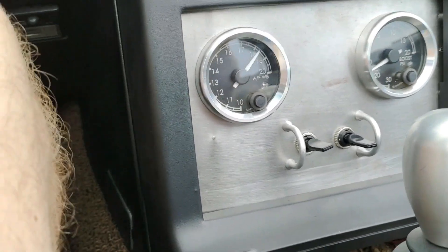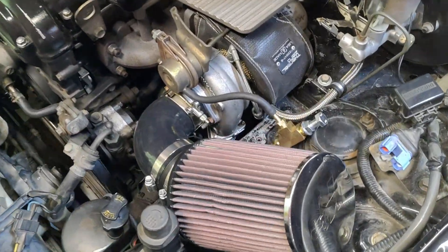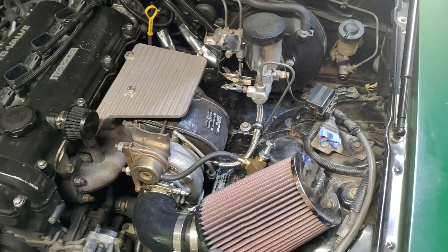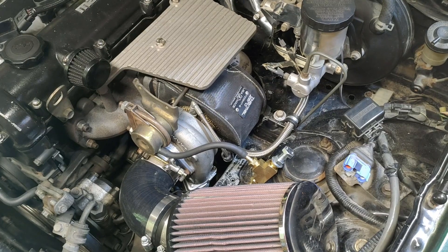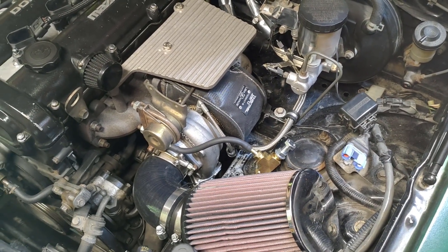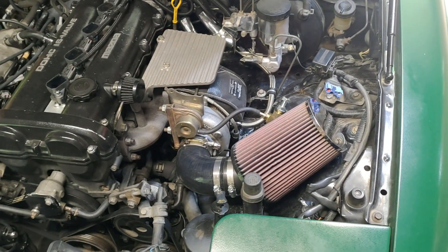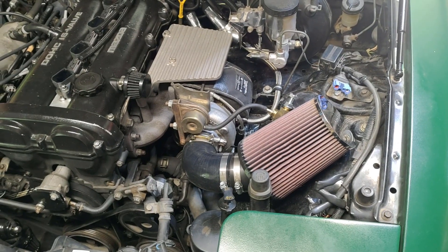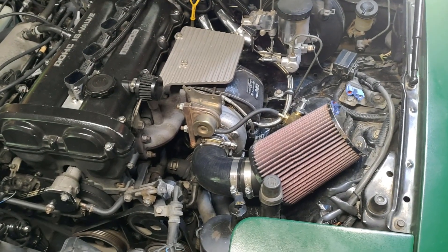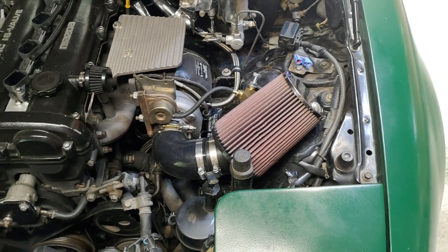I'm going to work the boost up slowly to about 12 to 14 PSI from here. It barely shifted at all — basically it worked out exactly as planned. I was aiming for about 10 and got about 10. We also saw some richness, and that is planned. When you're working your way into boost, tuning the top end of your table to be fairly rich is a good safety measure. When it hits about 10 AFR, it causes an effect almost like a rev limiter — the car just stops pulling — which is good extra protection.